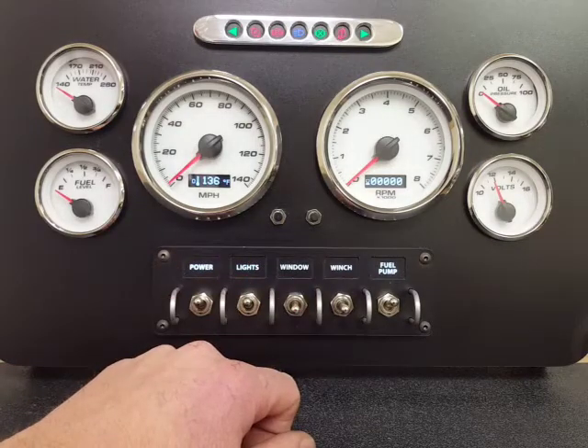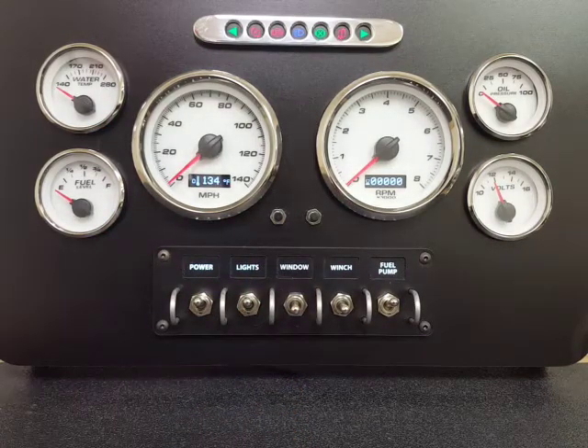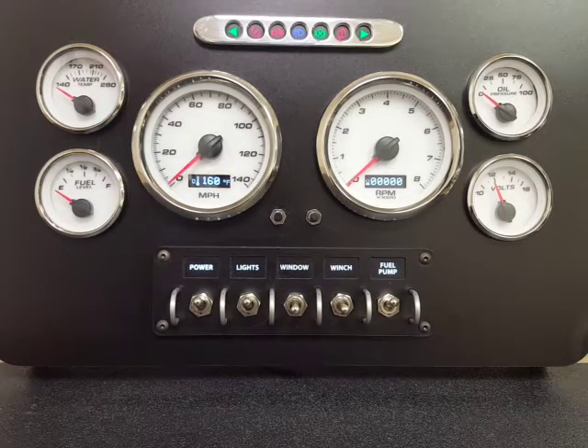What's kind of cool is you just use one of our senders. You can see the changing range on the oil temp. You can use oil temp, trans temp, pressure, brake pressure, whatever you need — boost, fuel pressure — it's all right in this screen, all ready to go. All you need is one of our senders. No additional boxes, no controllers, anything like that. Just wire it up to one of the inputs and you're done.